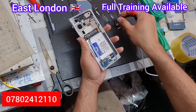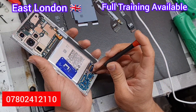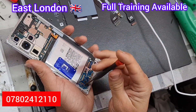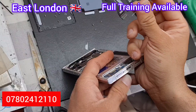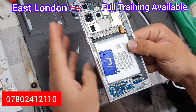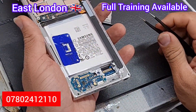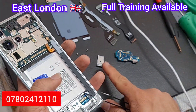He is going to take all three ribbons out first — disconnect the flexes and take them out one by one. Both black ribbons are different sizes so you'll know which goes where. There are three screws on the charging port, so take the screws out first. Before removing the charging port, take the SIM tray out. Be careful — the microphone hole is very close to the SIM tray, so do not put the pin into the microphone hole or the microphone will be damaged.